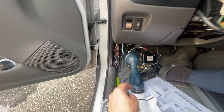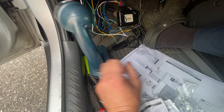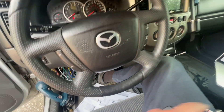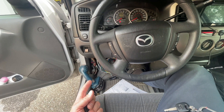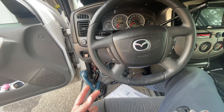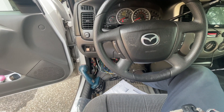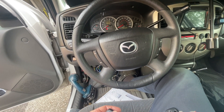Figured out some stuff. I did have to hook up that green wire, which we said was '12-volt ignition output input.' If I go into the manual on the computer it says: 12 volts when you have power, no power when ignition is off, power when ignition is on, and something like that after it starts - you'll read it if you do this project. So that got the car to crank, but it would crank and stall, crank and stall.